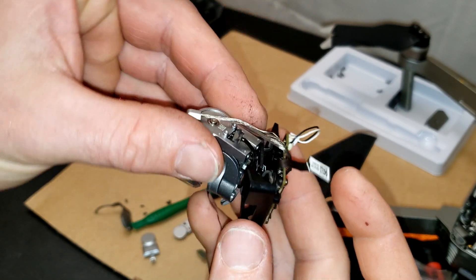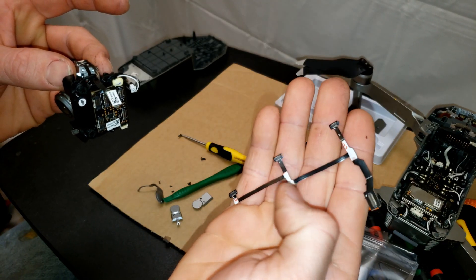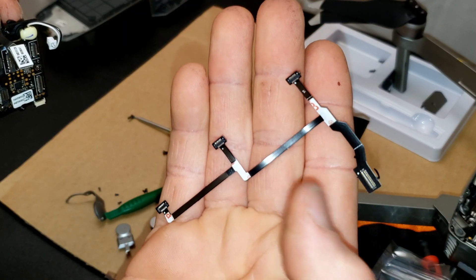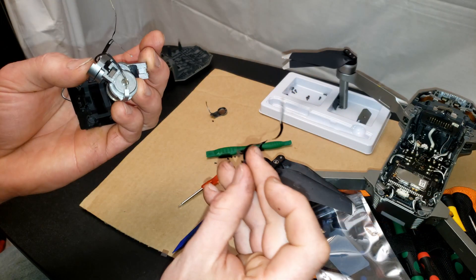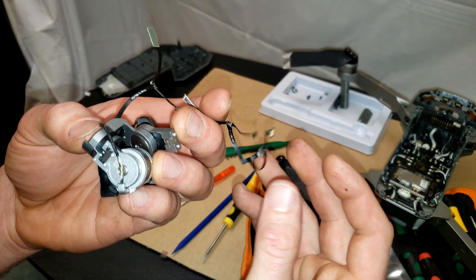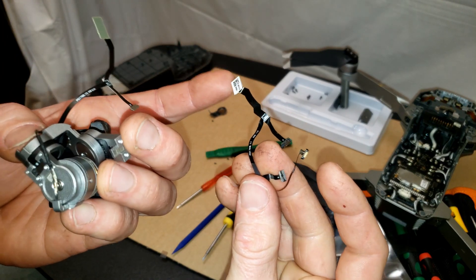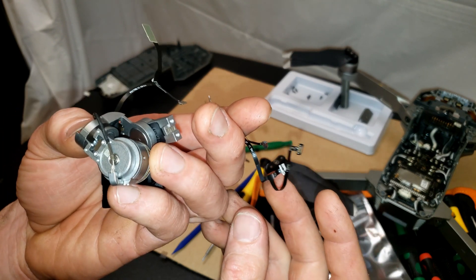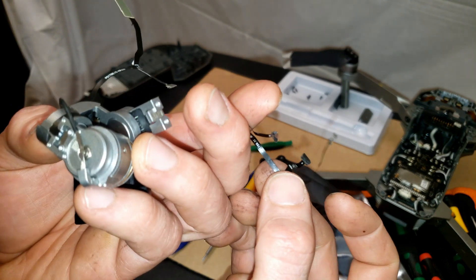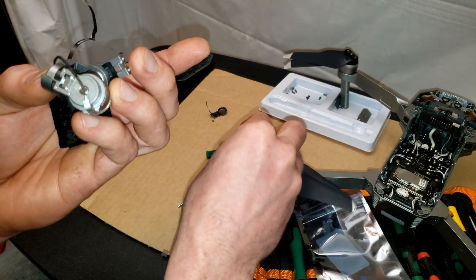Now you can snake that cable out and wrap the new one in. On the new cable, you'll notice it comes with adhesive, so just make sure to peel those and apply in the right spots. Getting the ribbon cable back on is very tricky. I was actually looking up another video — I'll plug it down below, it's like a 40-minute long one — but he has some good tips. One of them is to pre-bend your cable before putting it in on these white lines. There are actually arrows that show you where to bend.